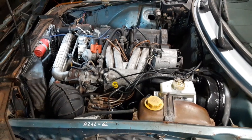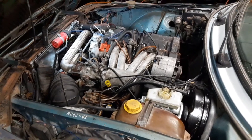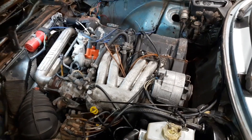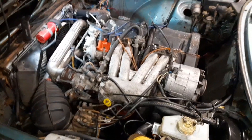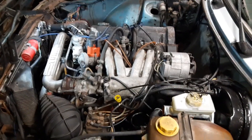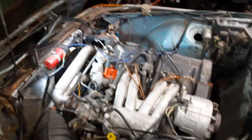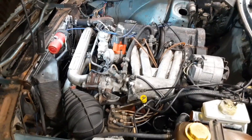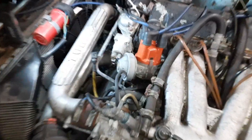Welcome back to another episode of Carolina Cars, where we're back in the shop looking at some idling issues on the 1980 Saab 900. Basically when it's cold it just runs like garbage, and as it warms up it gets to be running a little bit better, but there's still a little bit of hesitation. I'd already changed the spark plugs, checked the gap, and also did the distributor cap, which didn't really seem to change too much. I think it's a fueling problem and it's actually gotten a little bit worse, so it might be this warm-up regulator here.